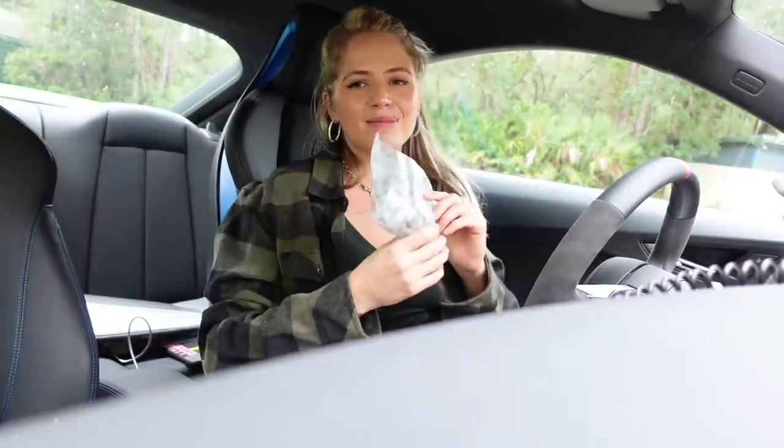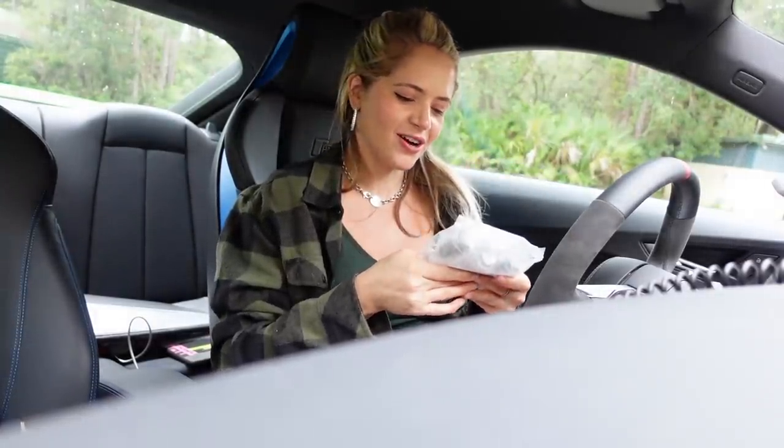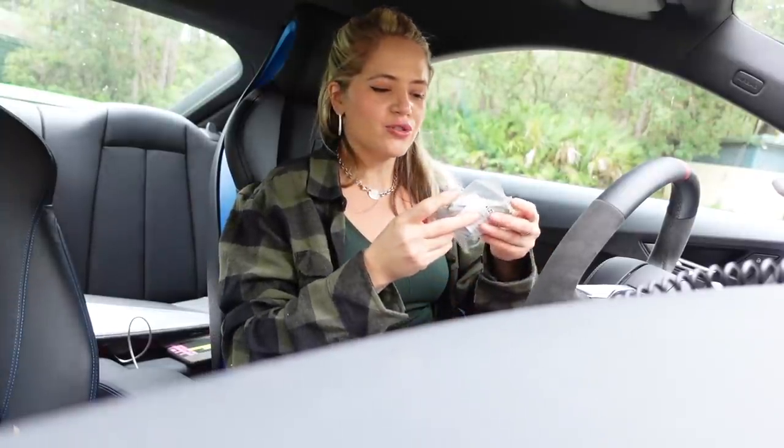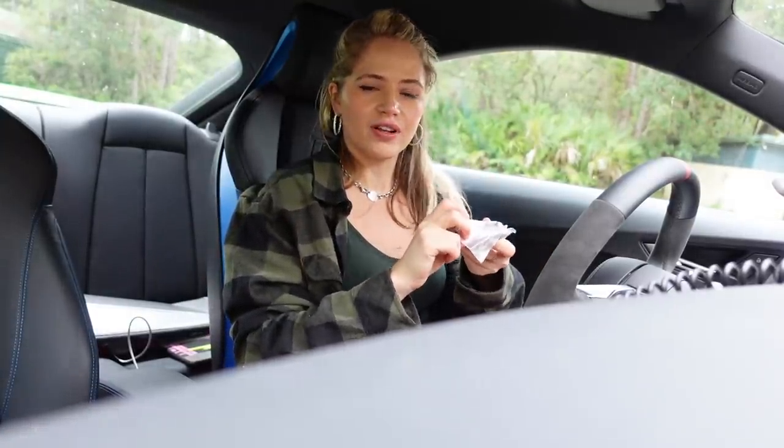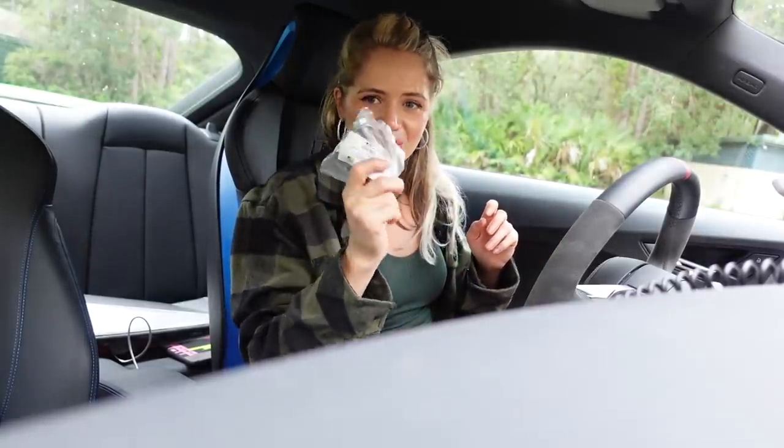I'm going to be replacing the one-time stretch subframe bolts that I used more than one time and installing the 034 bolts that come with the locking collars on it. I also have the new bolts for the dog bone mount that I did put on there. I put on the new one by 034, but I used the same stock bolts and now I have new ones. So again, thank you guys for looking out and letting me know.